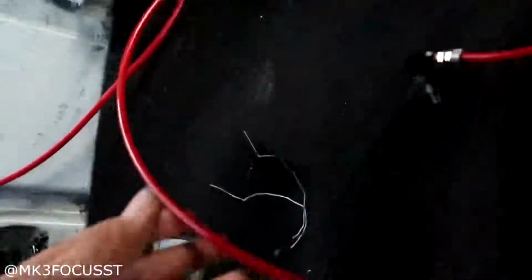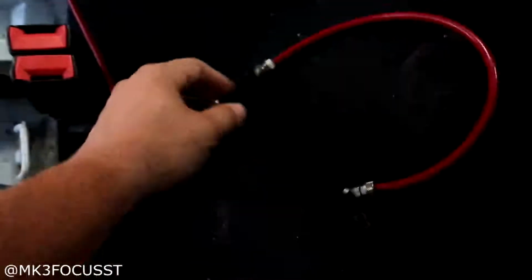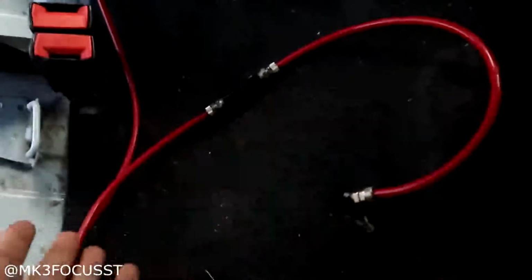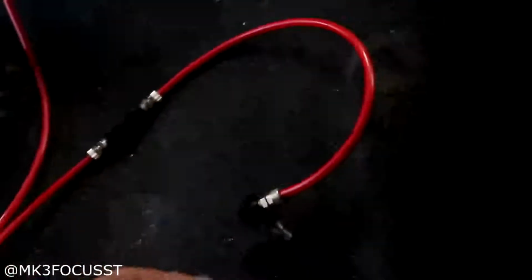When setting this up, once you already have it connected to the pump and you're about to run it through the front of your car, put the check valve on first, and I believe it said about a foot before the nozzle. This is for when you turn the car off, so all that extra methanol doesn't just go into your motor. It checks it. It's a stopping point that saves you, so when you turn your car on, it's not puddling up in your throttle body.